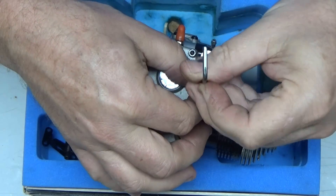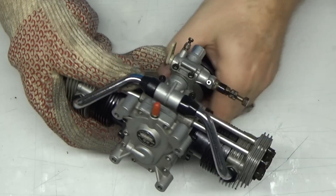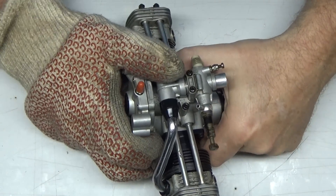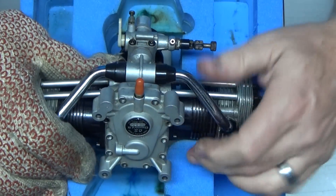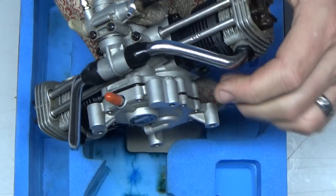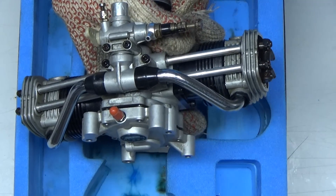I'm not even sure I really should be doing this. I've got it heated up and I think it's going to come off — I just hope parts don't go flying. Maybe just a tad more heat, and I can drop some oil in that gap. There's a gap all around here, so I'm going to drop some oil in there and heat it up some more.